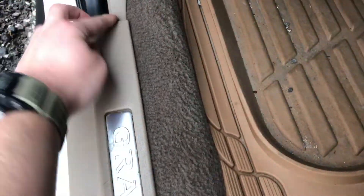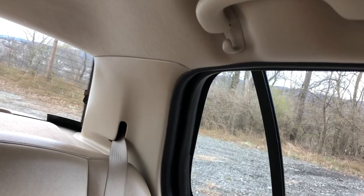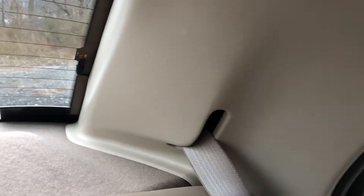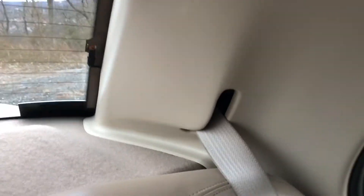There's really not much point in showing that because it's hard to get up under there. You can either lift these up and run your wires in here, or what I did was just peel back this weather strip and ran it in the headliner. And then it's just under here into the back. Then I went to that C-pillar, because these have a rear camera. In the Grand Marquis — which is what this is, and probably most Panther cars — this just pulls back and a lot of these panels just pop off. There's a whole bunch of space in here, so all my extra cable length is tied up and out of the way.